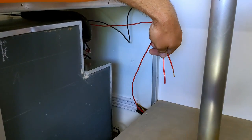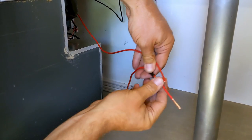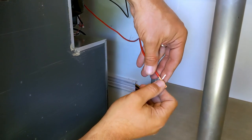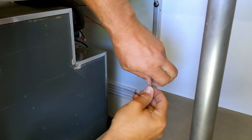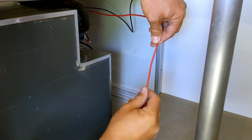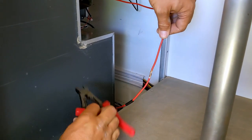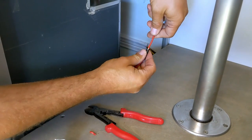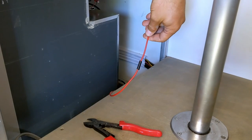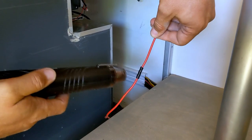For the positive, I need to run it from here all the way past the batteries and up to the fuses. If you know me by now, you know I'm a huge fan of soldering connections rather than butt connectors. So: shrink tube on first, strip way more wire than you think you need, twist them together. That in itself could do in a pinch — if you black-taped that it would probably be fine — but I'm going to solder it. The technique is to heat the wire, not the solder; put on a little solder to start, then once you've got your soldered joint, put a piece of high-quality double-wall shrink tube on there.